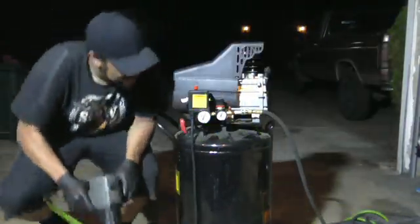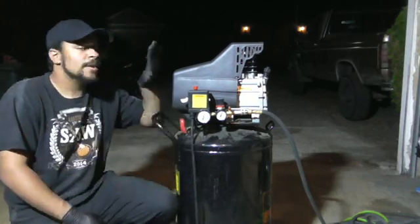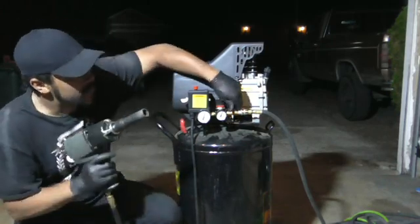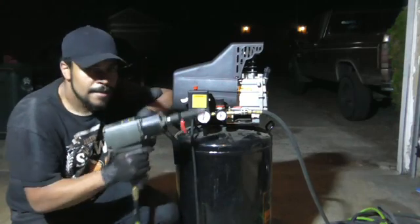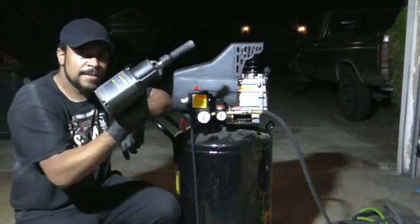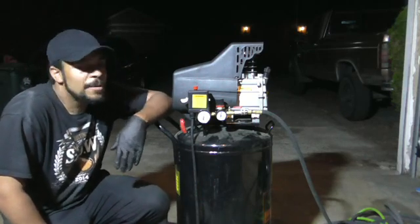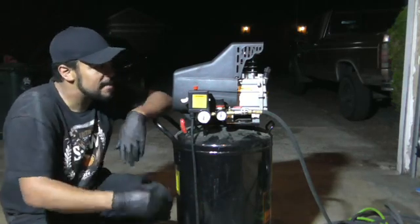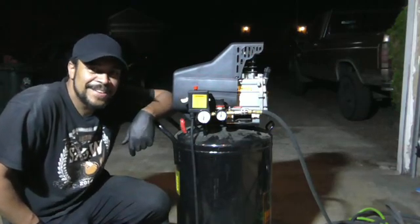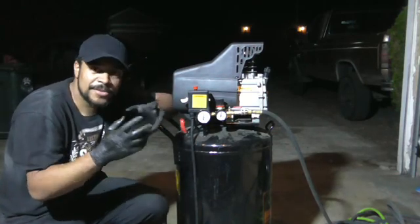Isn't that something neat? It looks like our little paper gasket fix worked. We're up now to 120 PSI and there are absolutely no leaks — I can hear just the tiniest one right there, but let's go ahead and open up the air valve. Now, the problem I was having before was I couldn't run this for any more than about five minutes at a time. So that is too cool. Two little paper gaskets made up at home by myself, and we have one fixed Harbor Freight special central pneumatic 21 gallon air compressor. Hopefully you guys learned something. This has been FenderMan. I hope you guys enjoyed it. Let me know what you think, like it and subscribe, and we'll catch you later.